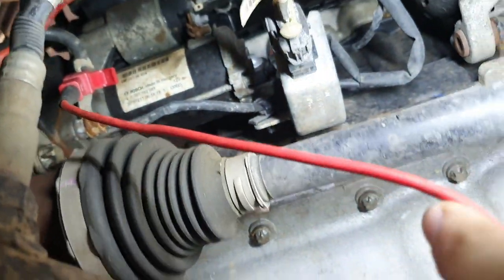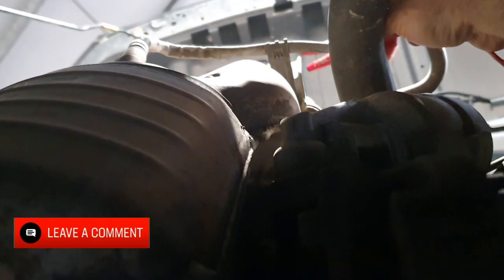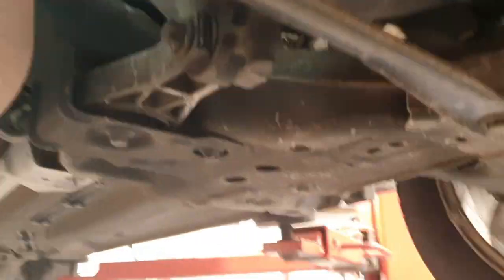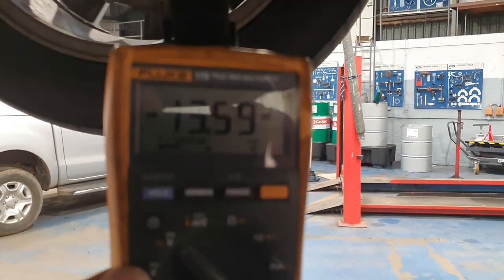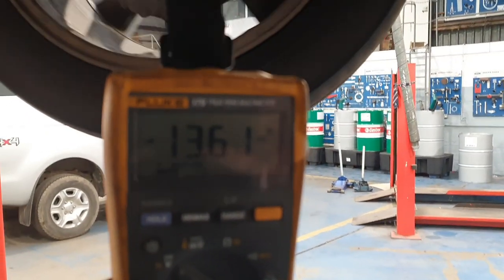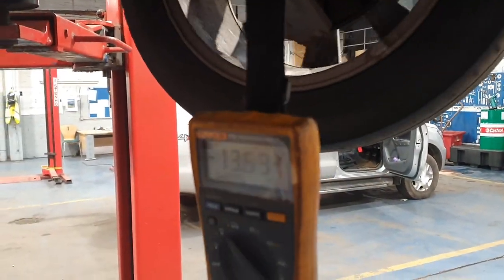If I move this now to the point where I was earlier — right up the top here at the engine lifting eye — yes I know my multimeter's in reverse, and we've got 13.6 volts. So that's showing now that we've got a grounding issue. Let's follow this earth cable and see where it terminates.